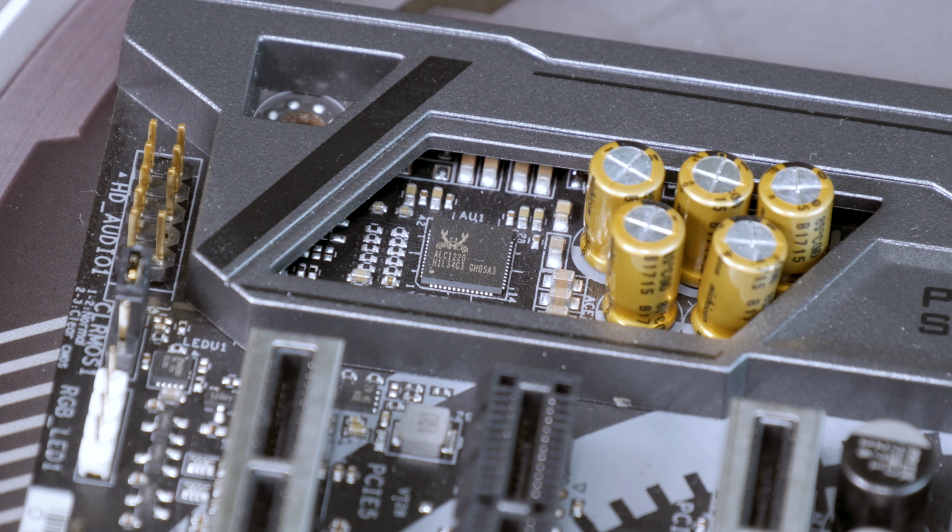Moving back to the PCI Express slots, you can see that beside one lonely PCI Express x1 2.0 slot, we have 4 full-length PCI Express x16 slots, supporting up to Quad SLI or CrossFire multi-GPU setups, while their electrical configuration varies from slot to slot and from user scenario to user scenario, and especially depending on the CPU which you plan to use, since the X299 platform has CPU models that support anywhere from 16 to 44 total PCI Express lanes.